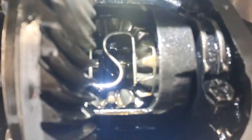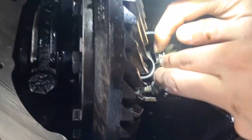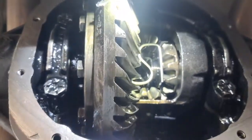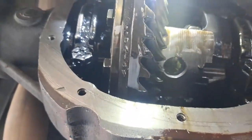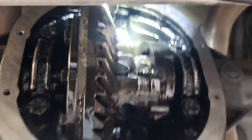Okay, you're set in. Hey, who wants to grab that C-clip out of the, there you go. There you go. Pull it back. Okay, who's got the pin? I got it. Rotate it. Don't do it like that. We wanna, actually that one held good, but leave it right there. That's how we took it out. No, I know, but sometimes it'll roll the pinion gears out of place. Mm. I think the preload spring was holding it pretty good, so we're good.